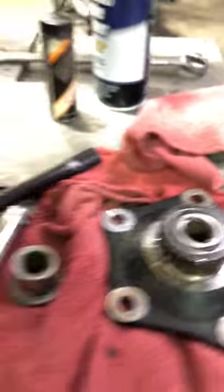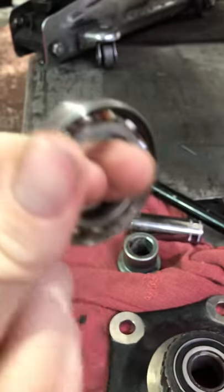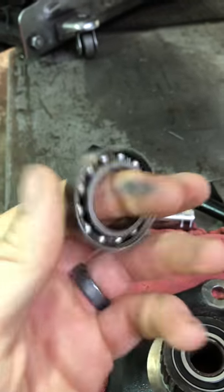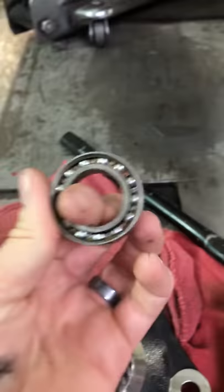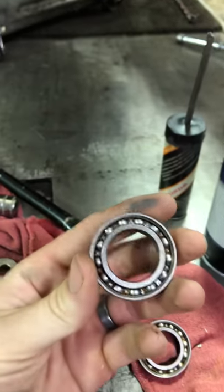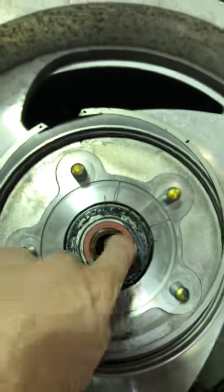The bearings are open on the inside, and as they wear out it starts to develop a little bit of noise. I can also feel it — this one seems like it's been susceptible to rust. These bearings are bad; I can feel a nice little gouging. They go inside of there with the open sections facing each other, they sit in here like this, and a collar goes in to rest up against the other bearing on your wheel.